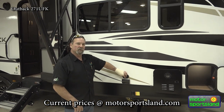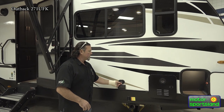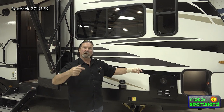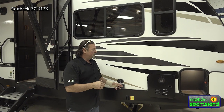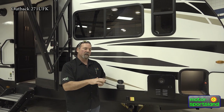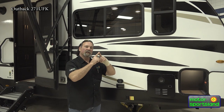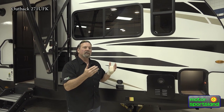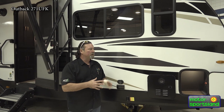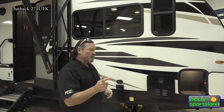This has Key TV, which a lot of people don't know too much about — it's cable TV and satellite. A lot of trailers still do the old-school setup with a single cable in the roof, split off somewhere, coming out to different ports. Key TV is a powered splitter — every line runs up to this powered splitter, and it sends each signal to each port individually. So if a splitter ever goes bad in the roof, you're not ripping anything out. If you're watching TV outside or inside for a duration, you're getting a strong signal right to each port.